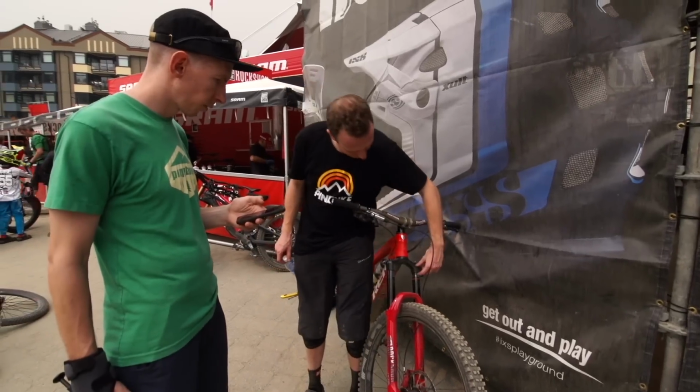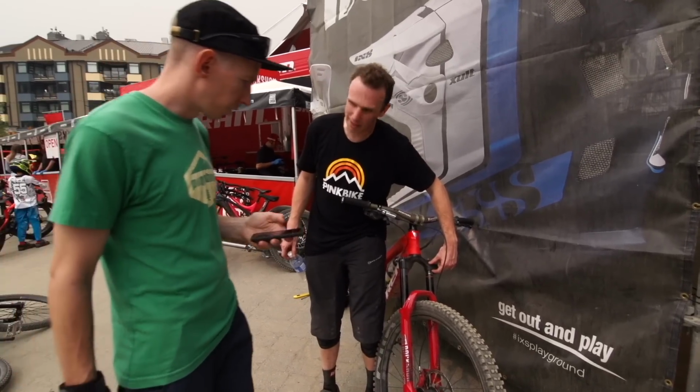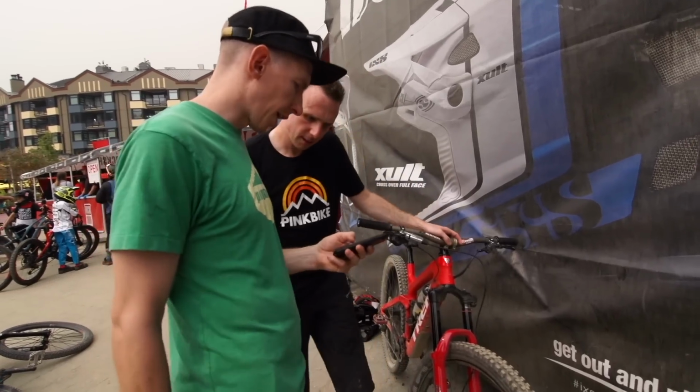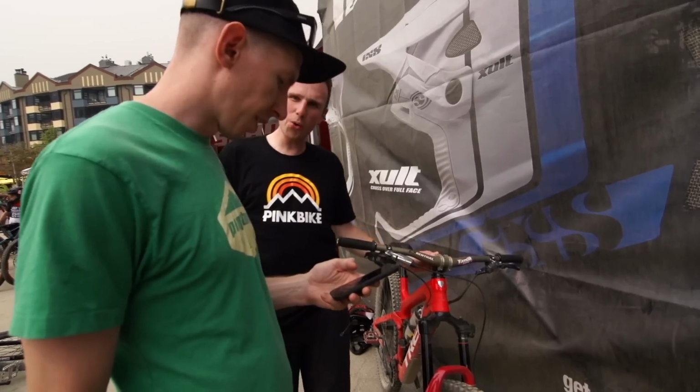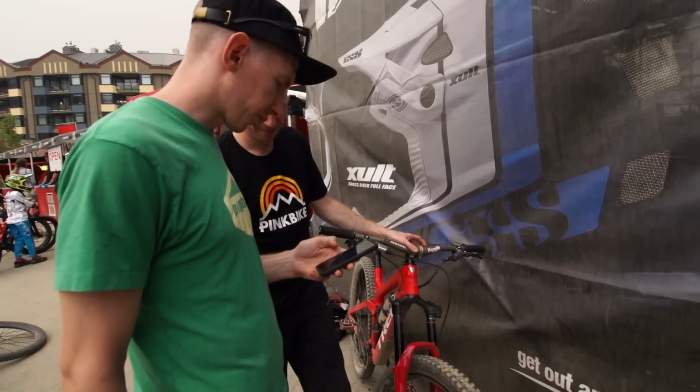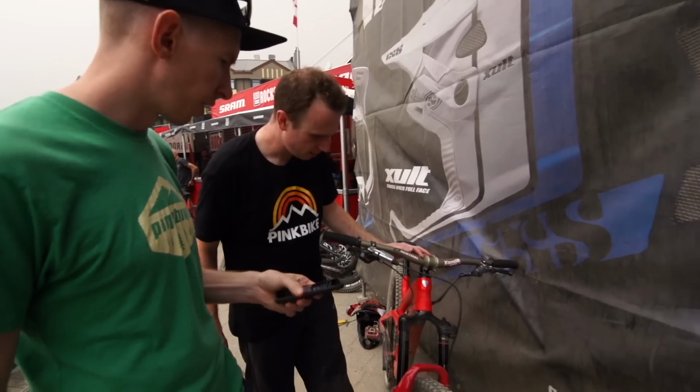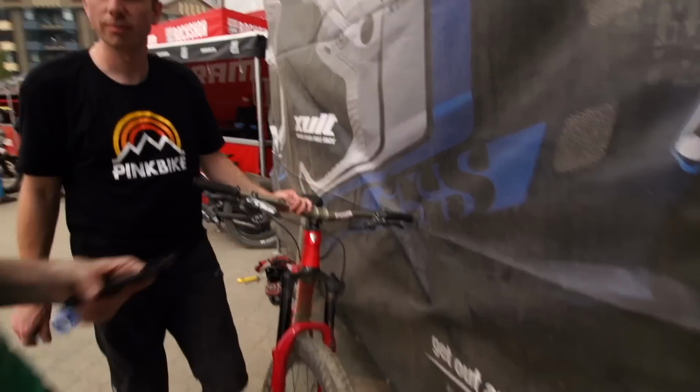So I get full travel is just below the debonair, right? No, it'll go all the way. Oh, okay. So your front stance is all right. You got 90 for your firm and poppy style. Woo! Yeah. Suggestions: you could add some spacers, and a little less high-speed compression. How many clicks do you have on that? 2. Yeah, and that's something you can play with.